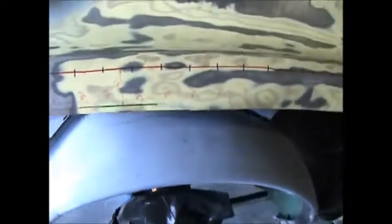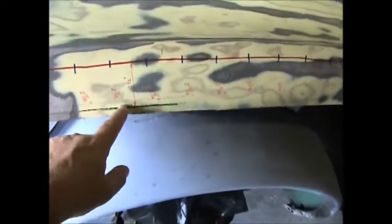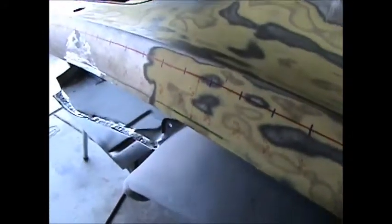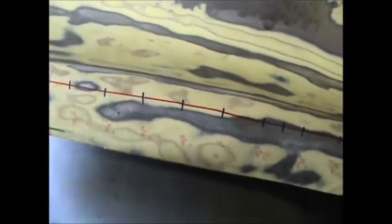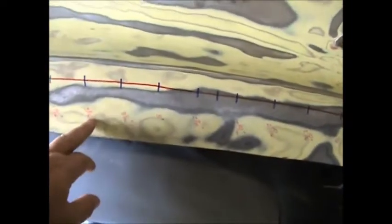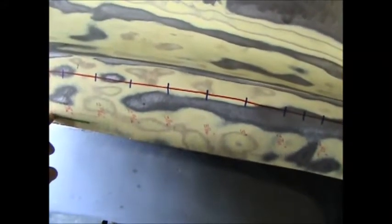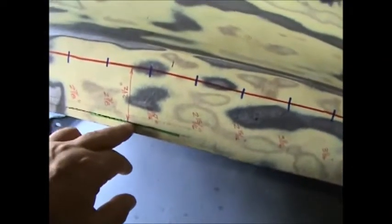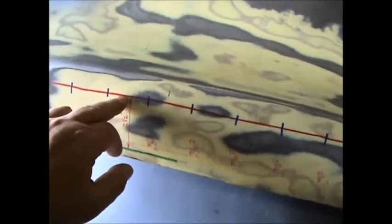I worked a little on the Camaro yesterday. I started doing my measuring for the quarter panel. Can you see the flange that we're starting to press into there? The new quarter panel will butt up to there, and then it'll be flush coming down to here. These measurements are from this line to the edge here, and from the top of the flange to this line, which represents the quarter panel itself.